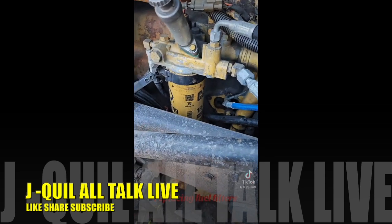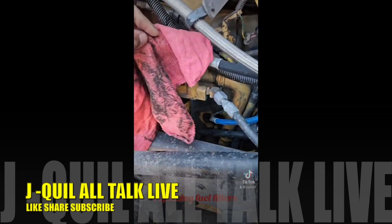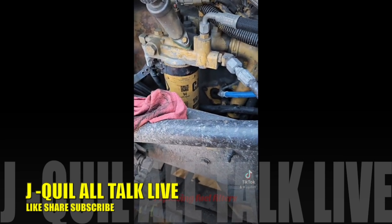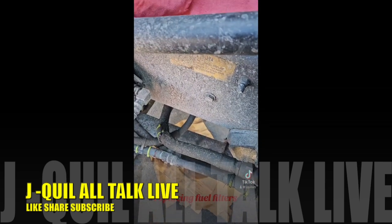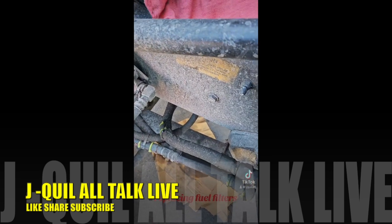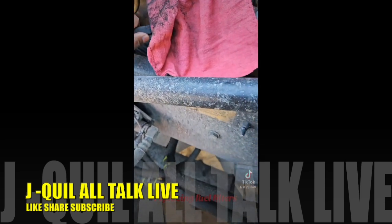So what you want to do, this is the primer pump here. I'm going to take this off here so I can prime it. But make sure you got a rag here so you don't have diesel all over the place. That's why I put the cardboard down there. So you're going to put this here, put some gloves on, already got it loose. Go real slow. You ain't got to go fast. You might hear it.